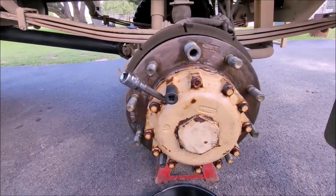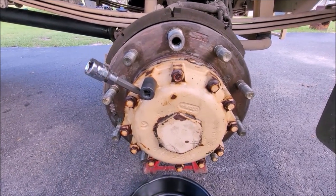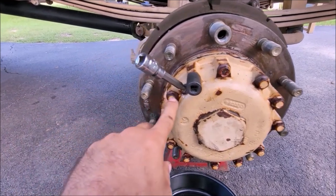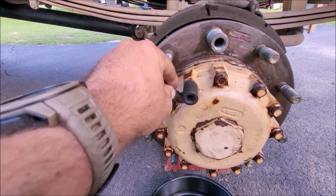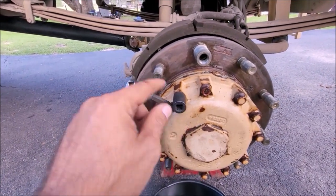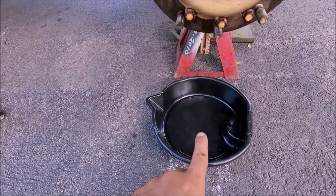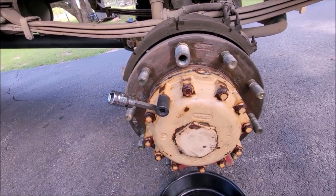My brake drum came off easy, so the next step is to remove the actual hub cover. I've seen some people take this nut off — I don't see any reason to since I'm disassembling the whole thing anyway, but you'd remove this nut and use the bolt to pull the axle if you were towing. I got my Allen key size in here for the fill, and since it's on the truck in the most stable position, I'm going to make sure that this is loose. Make sure you have your drain pan ready because once you start undoing all this stuff, the oil that's in here for the gears at the end of the axle is going to come out.